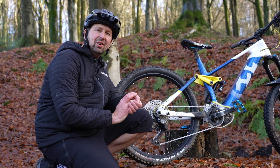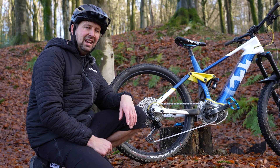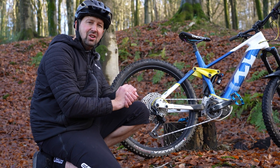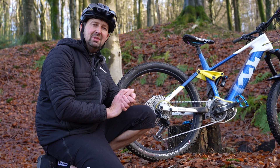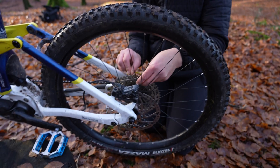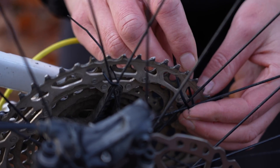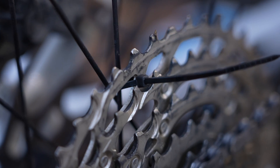Now the last hack in this video could really save your ride. Something that can happen on your e-mountain bike is a freehub failure. If your freehub fails, your cassette is simply going to spin round and round on your wheel without giving you any drive, and it can mean a long push home. But something that can save your day is a bunch of zip ties. All you do is thread them through your cassette and loop them to the opposing spokes on your wheel — repeat this process all the way around the cassette and this fixes the cassette to the wheel itself, allowing you to drive the bike along when you start pedaling.